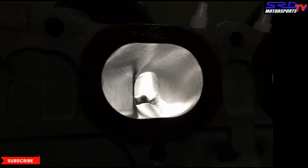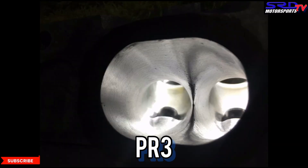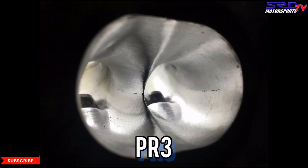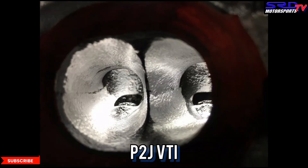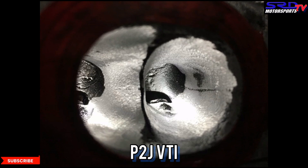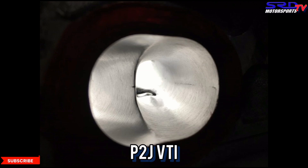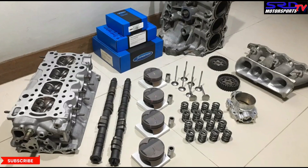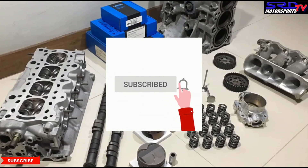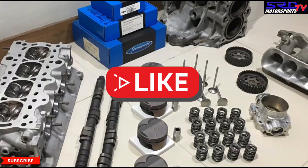It's interesting because everyone always concentrates on porting the intake, not the exhaust. Here's a B16 PR3 head that we did earlier — we tried to get the shape of the exhaust really good so that the efficiency is really high. And this is the VTI P2J head with a carbide finish. Once we get it shaped well, we smooth it out — the goal is to maintain good exhaust speed so that the RPMs are good. If this video is useful, subscribe if you haven't, hit the like button, and hit the bell for notifications.